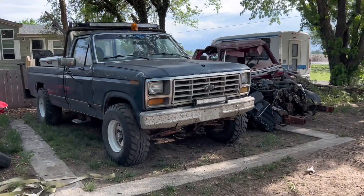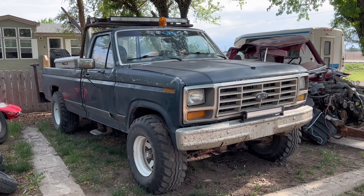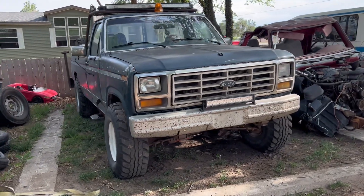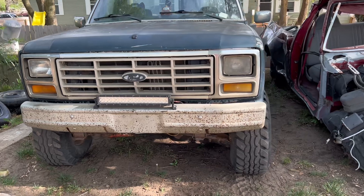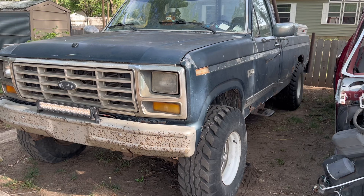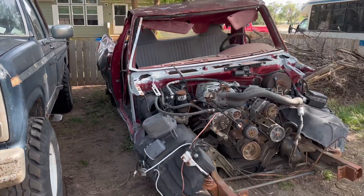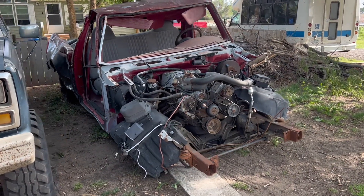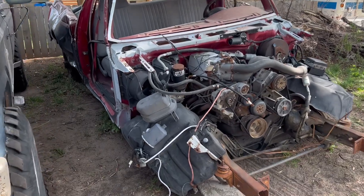Next up on the list is the old blue tow truck — Blue. A couple of you guys have probably seen that video. This is my '86 F250, it's got a 5.0 and a C6, it's got the lighter duty rear axle. I still need to check on gears, but we've got our parts truck here and it has a full floater rear end in it.